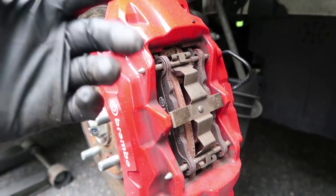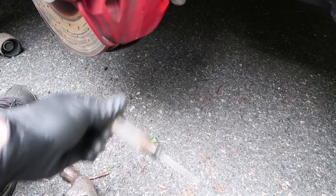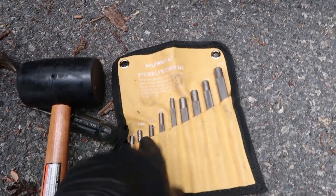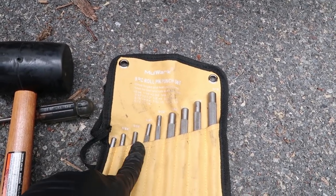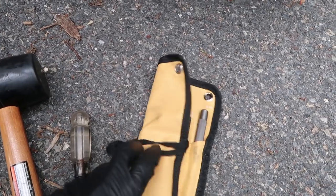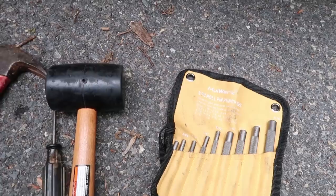The other advantage is that it's so easy to change these brake pads. All you really need is a hammer and a small Phillips head screwdriver. You could use a rubber mallet to save the paint on the calipers, and if you've ever built your own rifle, you could also use punch sets — though you don't need them. I'll put a link in the description; they're pretty cheap and roll up nicely.